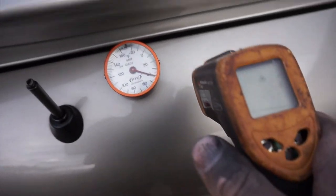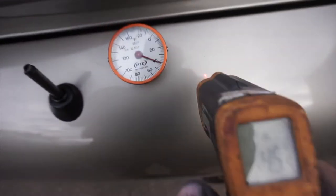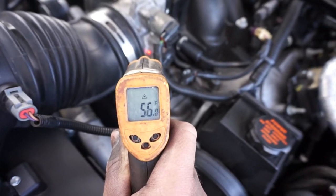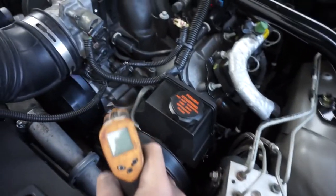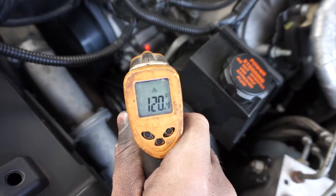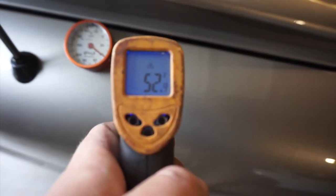We're back at the second stop. Ambient reads 41 degrees. Reference point shows 47, dropping to about 45.4 and then 41. Throttle body measures 55.2 on one side. Moving to the other side we get about 69.5. Lastly, the water pump reads 119 degrees. Ambient dead-on at 41 degrees — and sure enough the indoor reference reads high again at 52, which is about 10 degrees higher inside.